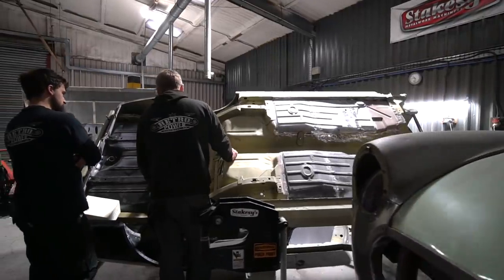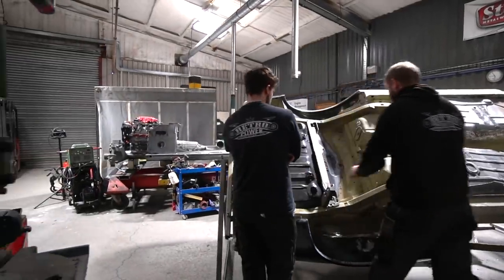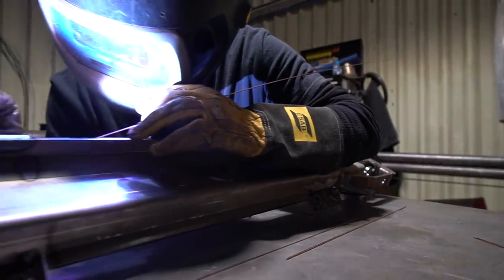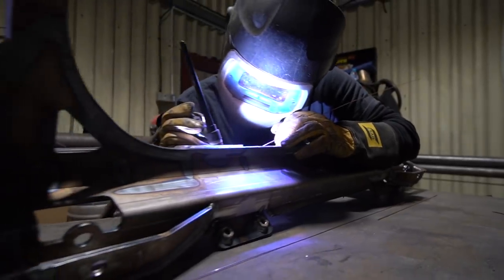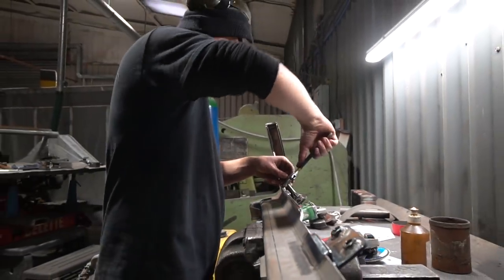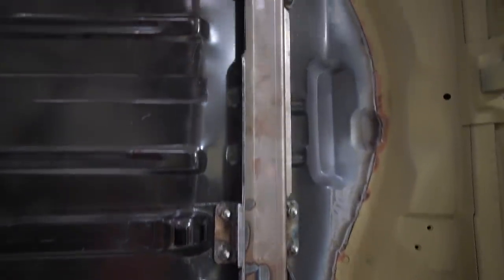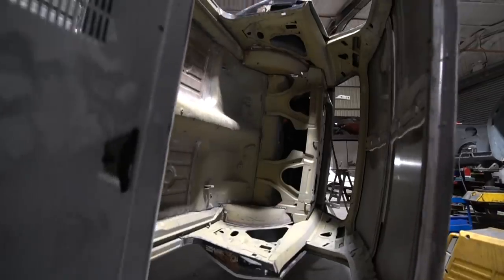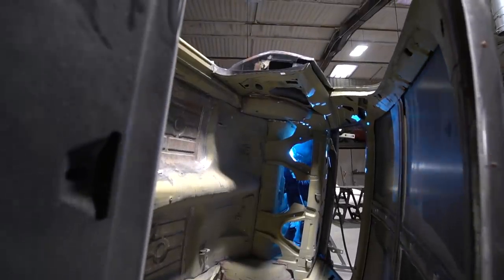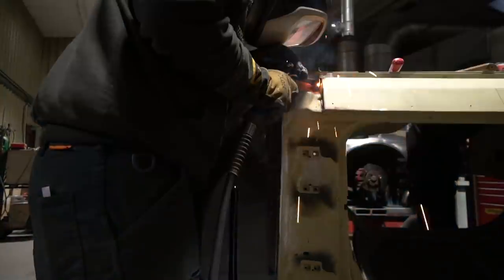There were a few bits that were inaccessible for welding — a bit around the steering column, a couple of threads that needed tapping, a couple of bits to trim underneath, and some welding on the rear panhard rod and damper mounting bar. This car has a kit to change the rear end to coilovers — a bolt-in (in inverted commas) kit from the States that involves welding bits into the shell. The car's been on the rotisserie today and yesterday to finish off those bits of welding, plus provisions for plumbing, holes for threaded inserts and so on.